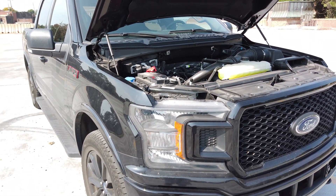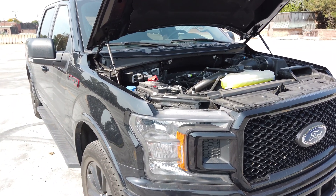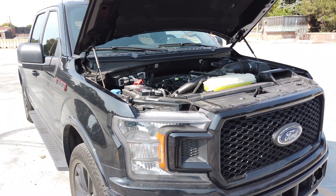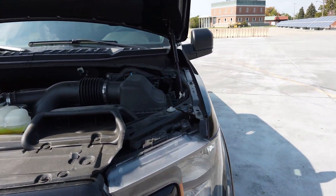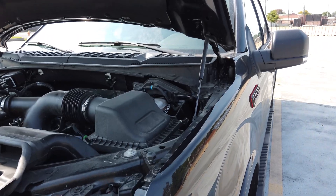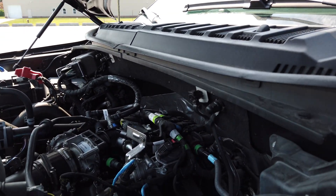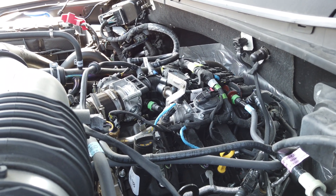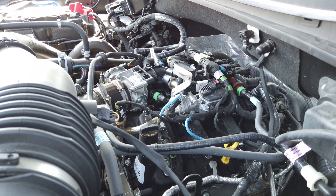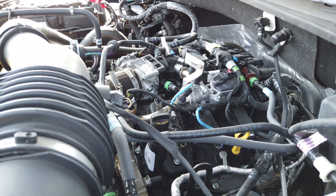This is a strong design. The two-piece engine block made me feel like it wasn't as strong for a while, but it's not like a Northstar engine where the crankshaft is in a different section of metal from the cylinders — that's what it initially made me think. But no, the rotating assembly is held by compacted graphite iron: the crankshaft, cylinders, and pistons are all in the compacted graphite iron.